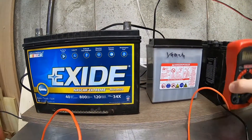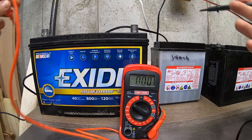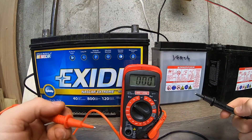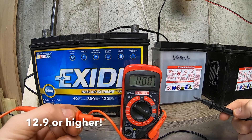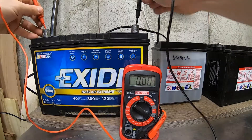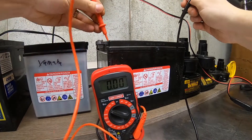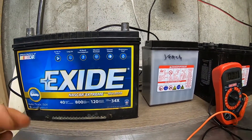What I want to talk about is voltage. What you want to see on a 12-volt battery — the one I just charged is reading 13.41, but a standing fully charged battery is going to be around 12.9 volts. It's not like zero is zero; 12 volts even is a dead 12-volt battery. If this was reading 12 even, it wouldn't crank a car at all. The Sportster battery reading 12.6 — we might get a start out of that, but probably not.